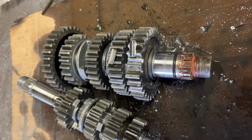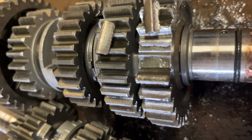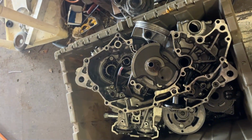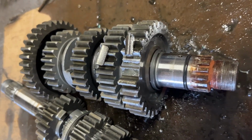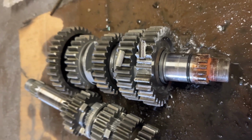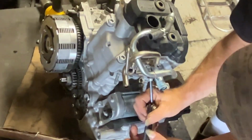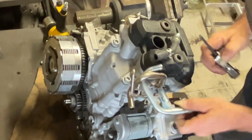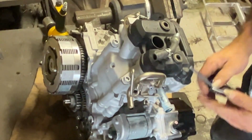He was ripping down the power lines, going from county to county, and second gear decided it wanted to weld itself to the shaft while he was ripping in a wheelie. Yep, they don't like long periods of time at high RPMs. Seems the shaft spit all the oil out between the little bushings, and the gear's going to weld itself to the shaft. That will absolutely whip you into the ground.